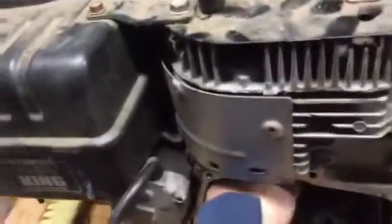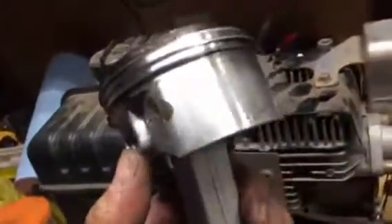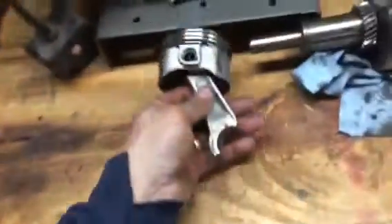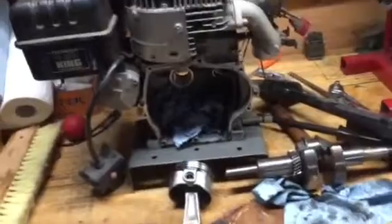Just trying to pull the piston out, but the vacuum was so tight it kept popping back up. So I've got to take the spark plug out to let the vacuum out and get that piston out. There we go. The piston is a nice shape — that's good, that's a nice shape. I can change the rod here and shove it back in from the bottom and not have to take anything else apart. The rod is done. From the time I put this motor in the garage, up in the hoist, pulled the motor out, got this all apart — it hasn't been 45 minutes. And if I had the parts I could put it back together and be running in 45 minutes.